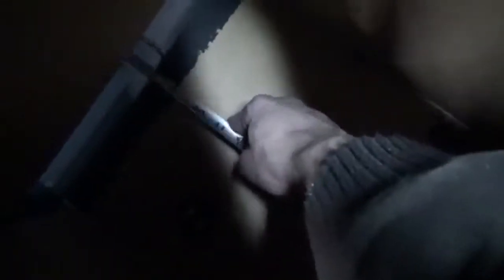And they're using, I believe, 1 inch thick, yep, 1 inch thick MDF on the outside. And I believe the walls are the same way. Now, the port height is 3 inches, from the bottom of the box up to the wall, 3 inches. So you got the width of it. Can't really get it in there. So the whole width of the box is 24. You guys can't see that. It's 24 and a half.